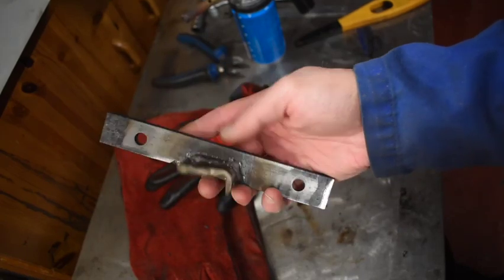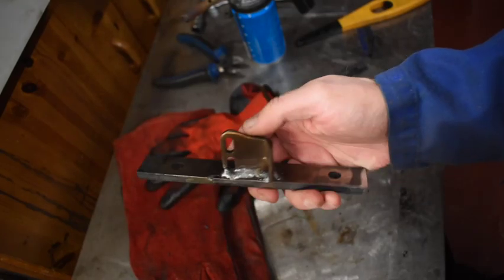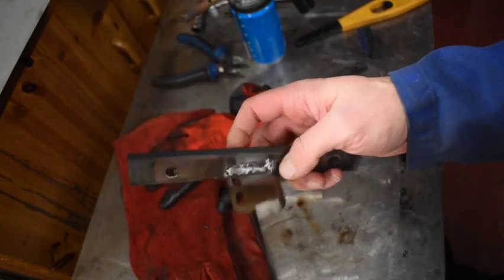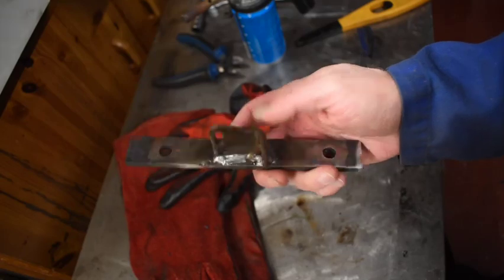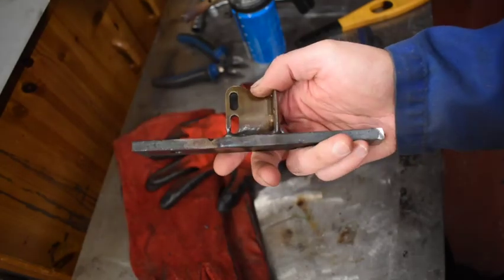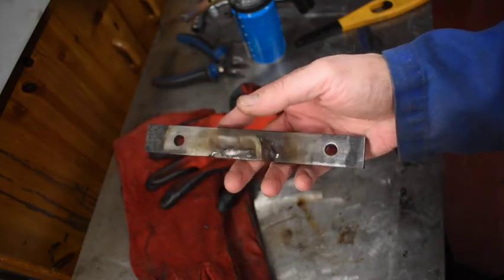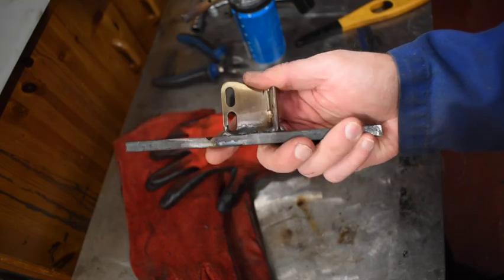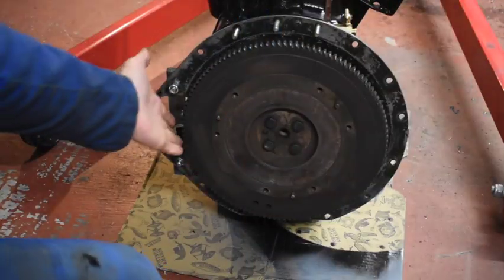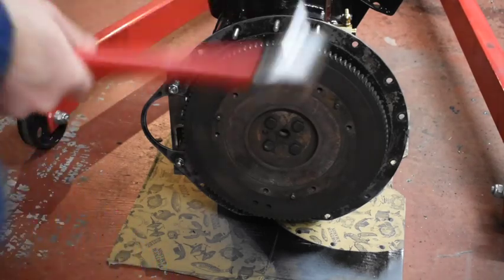After a short lunch and coffee break - you've seen I put a little bit of heat into the metal with the blowtorch before trying to weld it. That's because this steel is getting on for a bit thick for my poor little welder, so preheating the metal should increase my penetration. This needs to be quite sturdy because we're trying to get it to hold a fair bit of torque, but it should be fine because I managed to do it with a crowbar on the inline underneath the Spitfire. Let's try it. These need to be 42 foot pound.